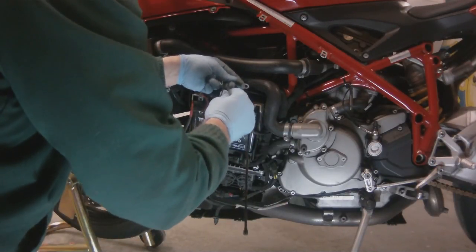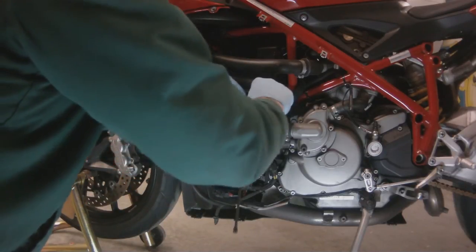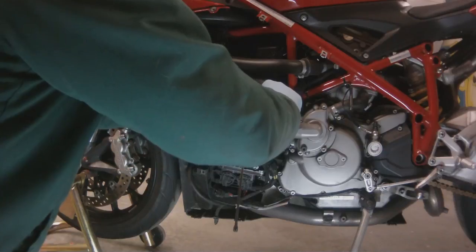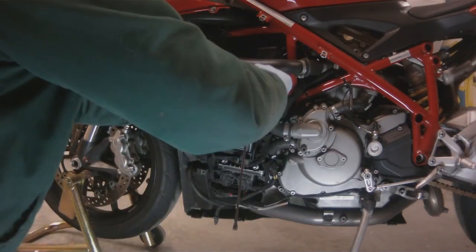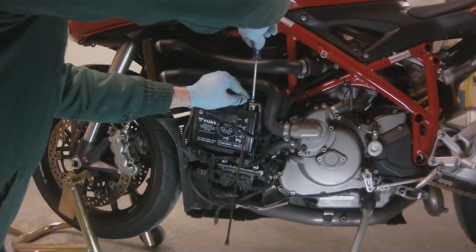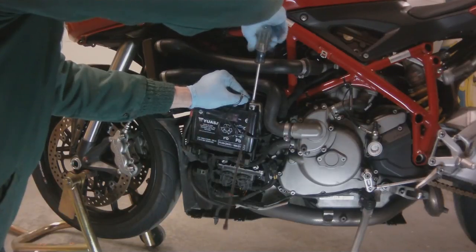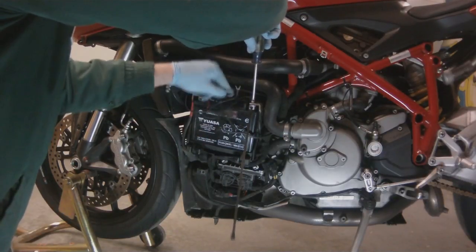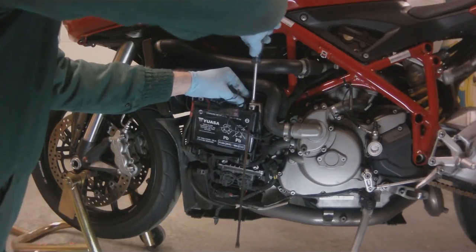A little tip when you're adding extra wires to your battery and to the battery terminals, when you put that little square battery nut inside the terminal, put a zip tie underneath it. The tip of a zip tie, you see it hanging there? It'll lift that nut up high enough so the screw will catch the threads.